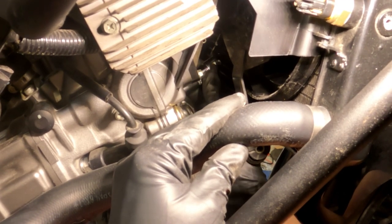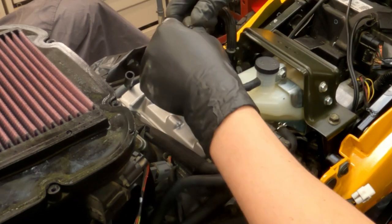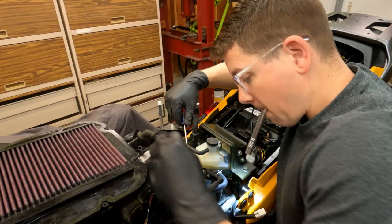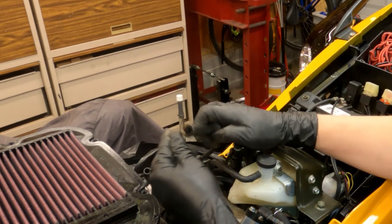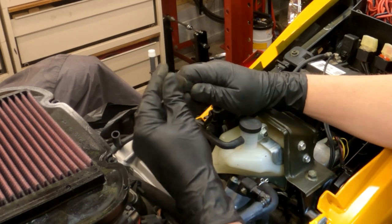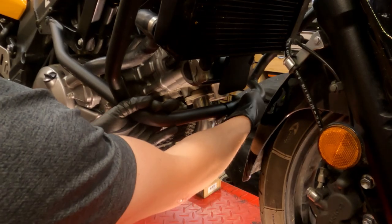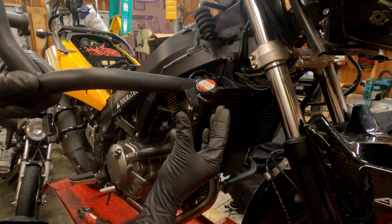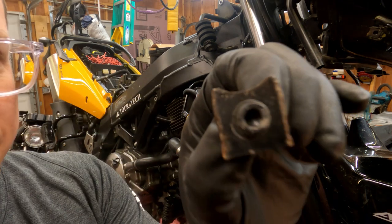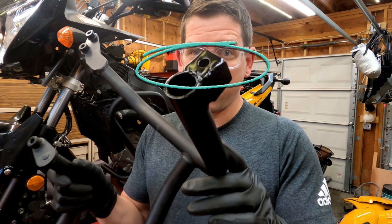The top spark plug on the front cylinder is a pain — you have to swing the radiator away a little bit. I'm not showing you the contraption of U-joints and extensions I had to use; you're just going to have to see what works for you. Something that's never happened to me before: I couldn't get the spark plug socket onto the rear cylinder plug. I realized the rubber piece from the boot was stuck down inside, so I had to fish it out with a long screwdriver and pick. Once I realized what happened, it was easy. When it comes to the crash guards, you can see they're not sandwiched together in the center — the last time Doug dumped this thing, a tab broke off along three welds so it can't squeeze together. We just ground it down, re-welded it, and painted it. Done.